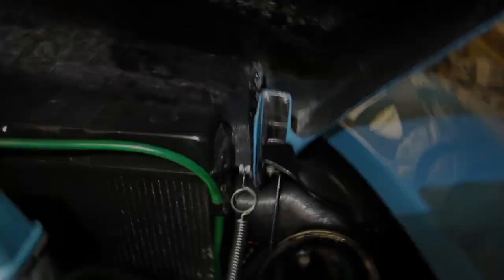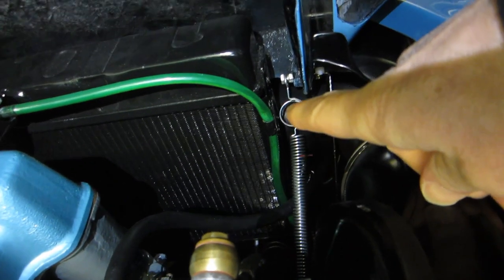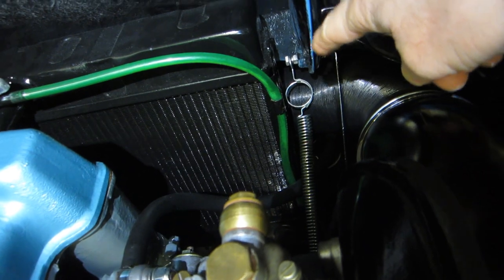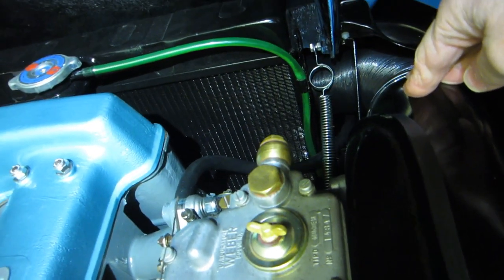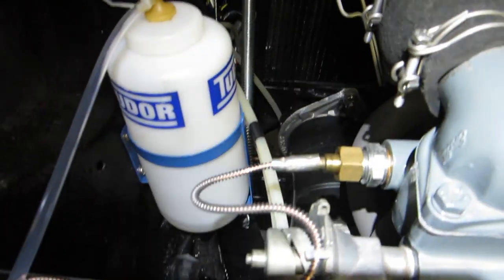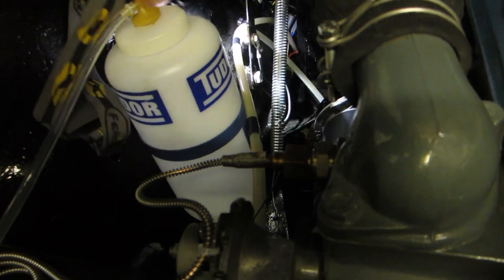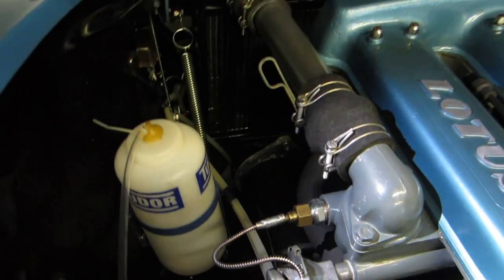In the case of the Series 2, in Series 1 there's a spring either side which goes down onto the chassis. Then a bobbin in the bonnet and a screw — just a spacer nut. You have to get hold of that ring and hook it on, which is pretty tough. These are new springs — I tried the old springs and they're very similar, so I've put the new ones back on. On the other side, same idea with the screw running down to the chassis — you can see where it hooks onto the chassis, just in a hole.